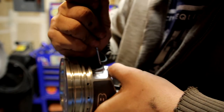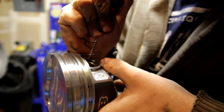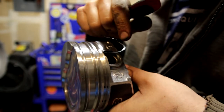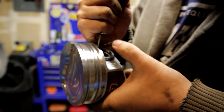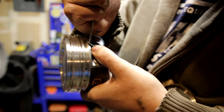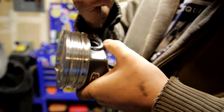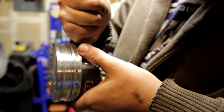I found it's easy to go inside of the spiral and just keep pushing and keep working it through. Because you'll be able to tell if it's gone through and you're pushing your wrist pin out, or if you're actually locking it in place. Once you get over here again, you can come up here to the top and press that back down like that. Then use your thumb to push that over and you can use leverage again to kind of work this thing in. It is sort of a tedious process.